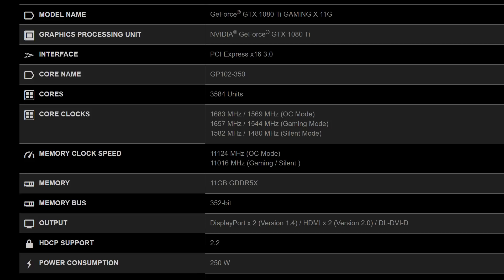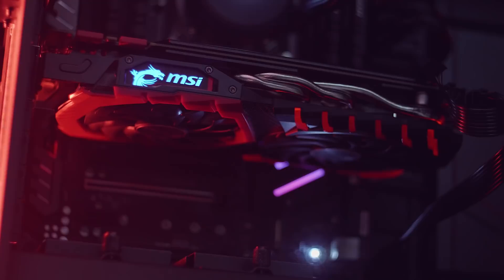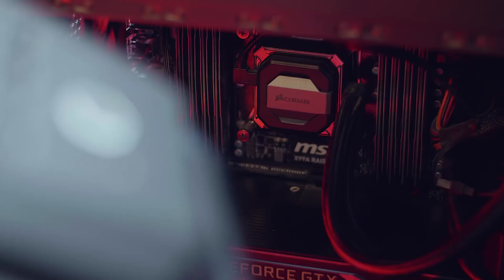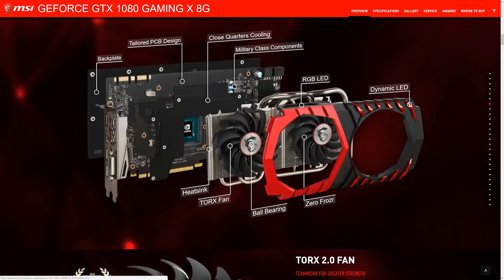The more of these cores you have, the better performance you will see in both playback and rendering. I would suggest getting at least 1,000 cores if you're looking at editing 4K footage. There are also different technologies the graphics card comes with — for example, if you want to edit in virtual reality, make sure your card supports that. MSI provided us the GTX 1080, which is a beast of a card, but honestly we're not seeing much difference between the 1070 or even the 1060 we also have at the office. That again proves that the processor is the most important part within the chain. The MSI card stands out for its cooling design, which they also won a prize for.